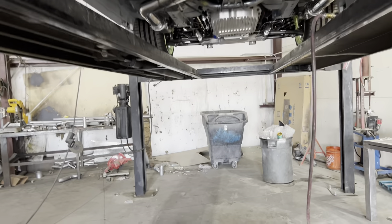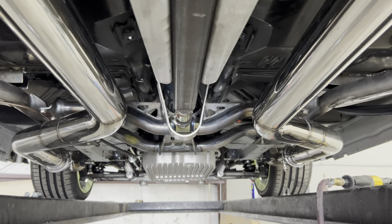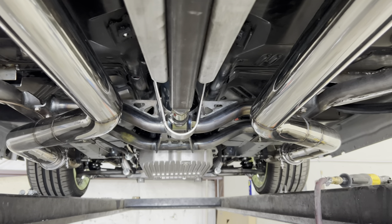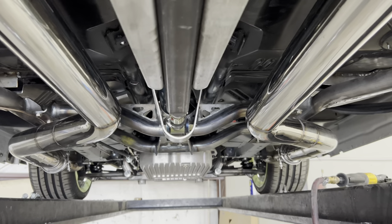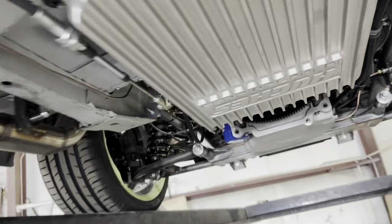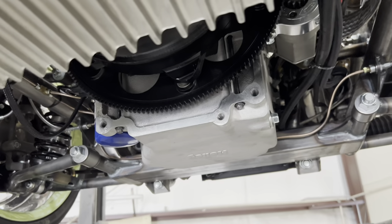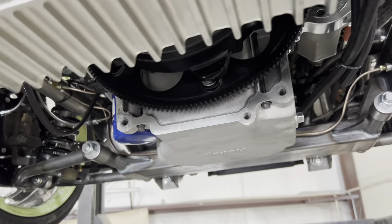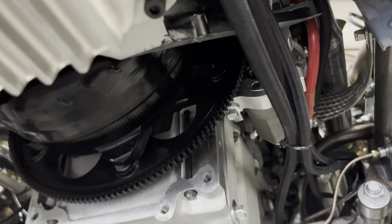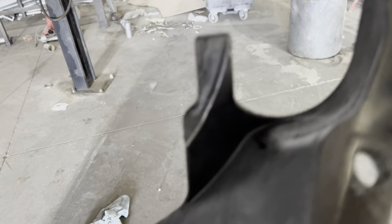The big news for today is this: we got the car started up last night and I got to hear it through the mufflers for the first time. It quieted things down considerably and I was able to hear things I wasn't able to hear when I first drove it around the block. The big noise coming from somewhere in the engine bay was narrowed down to this general area. As I got under the car, it was really noticeable the noise was down here. This morning I pulled off the aluminum cover and there is my problem — the flex plate was grinding itself through this aluminum.